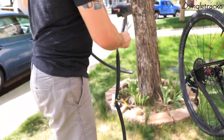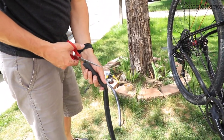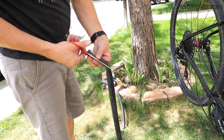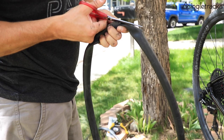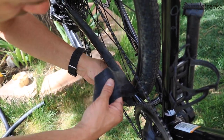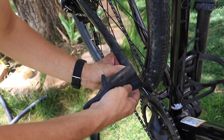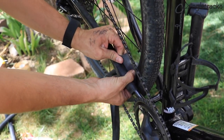Since the tape-on-tape thing looks kind of janky, we're going to clean up the exterior look with an old inner tube. I use an older one from a road or gravel bike. The less material you can get away with on this part the better, because it's going to keep the overall profile of the chain stay a little more narrow. I cut the tube straight down the middle so I'm not double wrapping — I can just flatten the whole thing out into a single layer going around the chain stay.